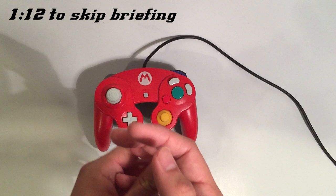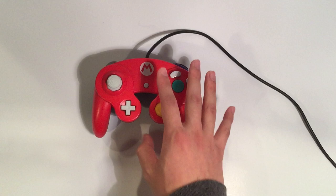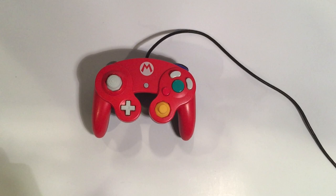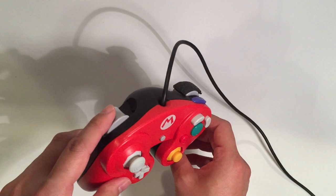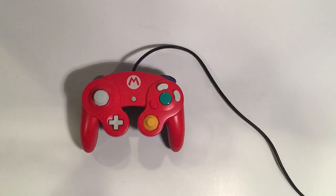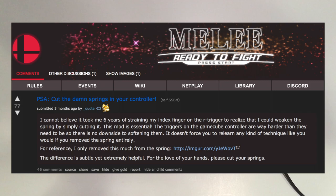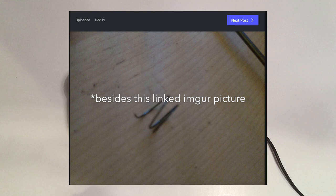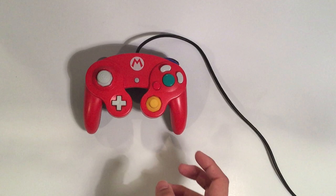Different generations or variations of controllers have slightly different parts in them. While mostly the same, some springs vary in height or thickness, and as a result some may be harder to press than others. This isn't too much of a new topic — I've seen threads and Reddit posts regarding this issue. While some people recommend removing your spring altogether, which causes a completely different feel, I recommend just cutting your spring. I did originally see this idea from a Reddit post I'll link in the description, but there weren't any visual guides or videos to help, which is what I'll be doing here.